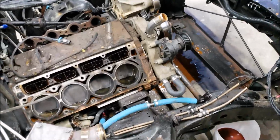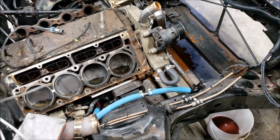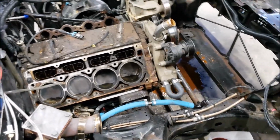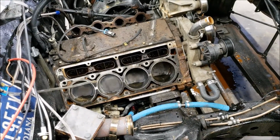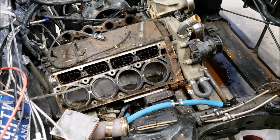It's going to get probably the LS9 head gaskets, I'm guessing. I don't even know. I thought about going back to a graphite gasket and then do an O-ring on the head. I will let someone else figure that out for me. Probably go ahead and do the ARP head studs. I'm not doing that Chinese nonsense. Everybody else does. I'm not as sheepish as everyone thinks.